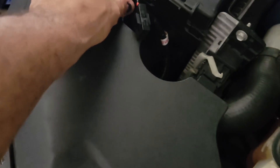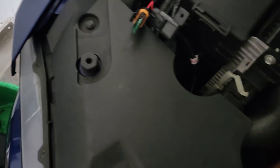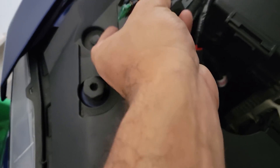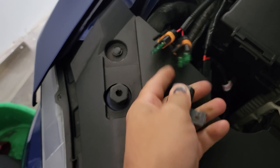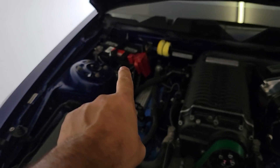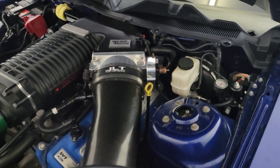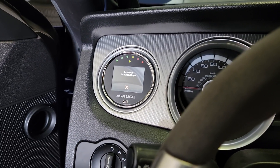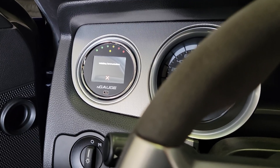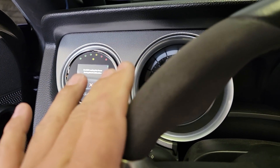That's actually why I love that I own these vehicles - we can test stuff out. Now I'm going to flash a tune. When you flash a tune and you have a dual fan heat exchanger, it's sensitive to voltage. If you've got two fans flying, it could be a problem. So I'm going to disconnect the fuses, put a charger on it, and flash the tune Junior made to test some other things. I'm going to upload a tune Junior sent over - not going to give too much away, but this is all an effort to see if we can remedy the issue with this throttle body specifically.